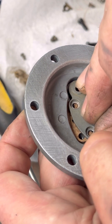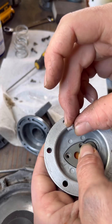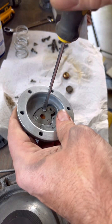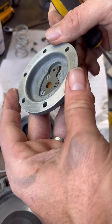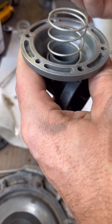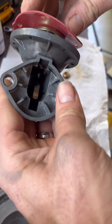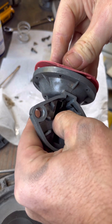This is the little action I did with the gasket in there. The new gasket comes with the rebuild kit. Just put it all back together. For the diaphragm spring, I just ended up using the original — that's pretty much recommended from what I've seen. The new springs that come in the kits might be too long and give you too much fuel pressure, so I would recommend using the original.